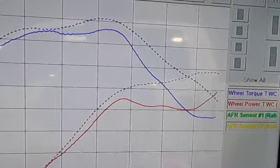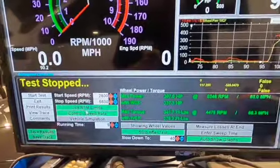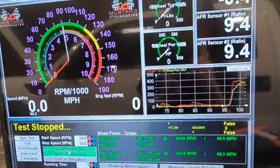That's quite a bit. And when you're moving such a big truck like the Raptor, which weighs, according to this, 6,500 pounds, you need as many foot-pounds of torque as you can just to be able to move it comfortably. So overall, I think this was a great opportunity to show why I don't like to do can tunes. They do a lot of copy pasting. They really just get one car with similar mods, they dyno it, and they just send that out to everyone. And a lot of the time you just run into problems like this.